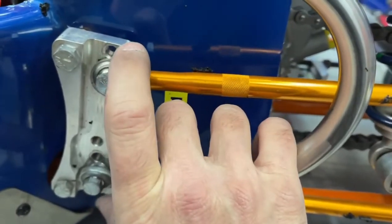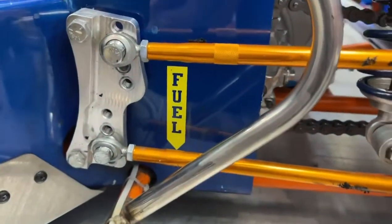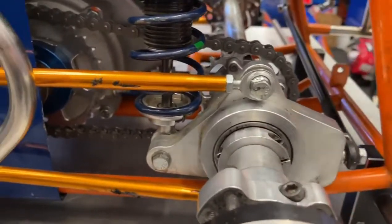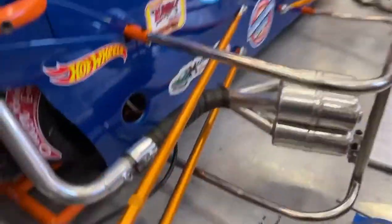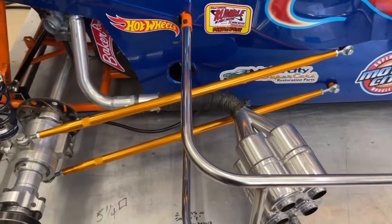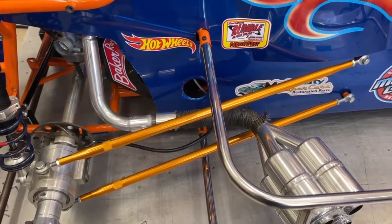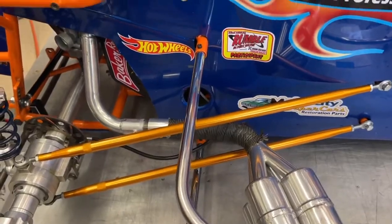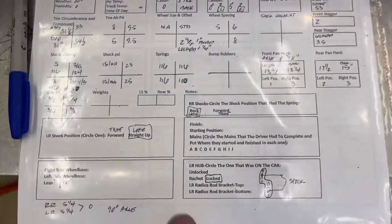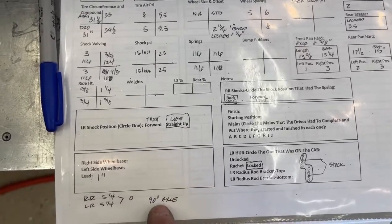The other adjustment here is: for your car to be tight, it's in the upper holes; to loosen it up, you keep moving it in. If you want to turn this birdcage clockwise or counterclockwise, you can move this up or down in the holes as well. On the other side, these big long radius rods are what control the axle. We typically don't change that - we always run it at zero on this particular car, which is Animal. On the Honda car we run it a little differently, but on this car we always run it square. We call that square, and on our setup sheet we're running at 90 degrees.